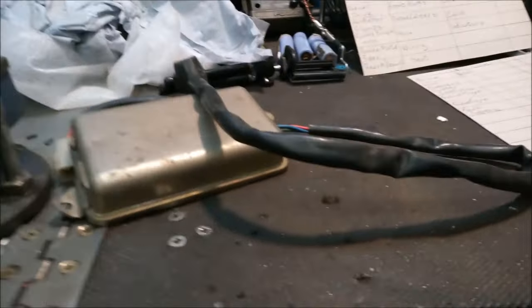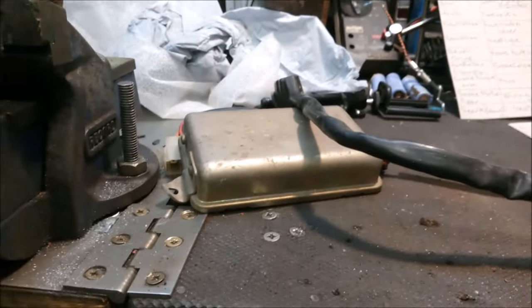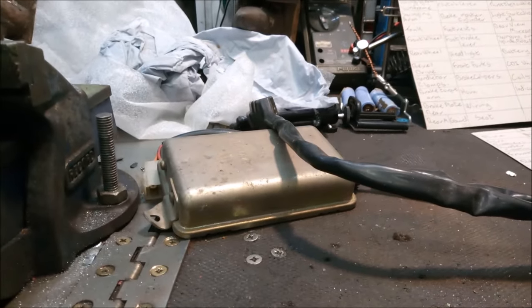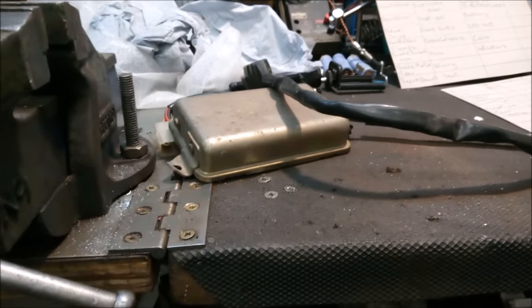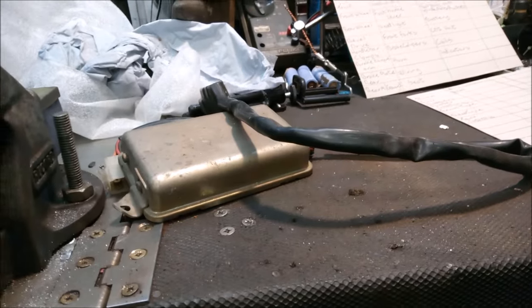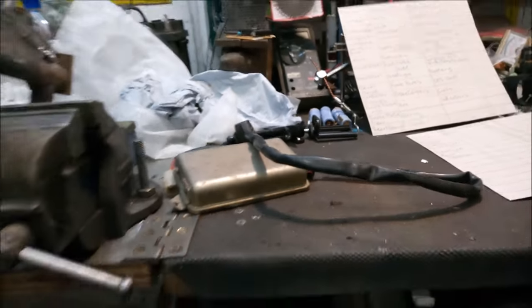And then I had a bit of luck. While I was in Dave's shed, I found my CDI unit as well, which looked in pretty good order. That must be one of the newer ones. They have a habit of going wrong, but often it's just the condensers in them go. So you can change them and get them sorted again.